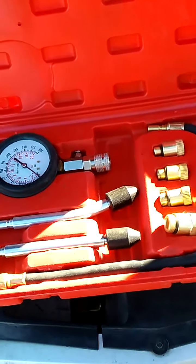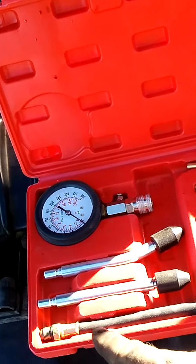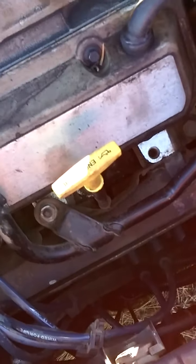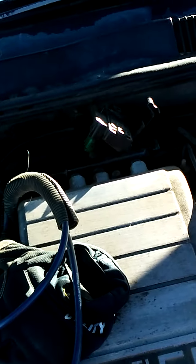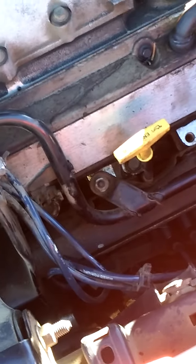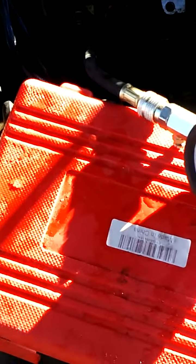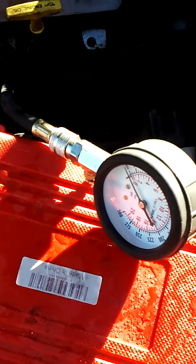Compression tester time — those back ones are horrible. Grab your pressure tester and that line will screw directly into it — the one that hooks directly up to the tester. Thread that right into the spark plug holes where you got them from. I'm going to do the front first in case I end up cross-threading this. Now that it's threaded securely and clamped on, make sure the line's empty and crank the engine eight times, then come out and read your gauge.